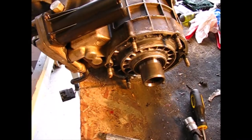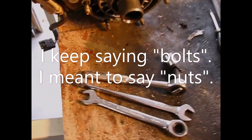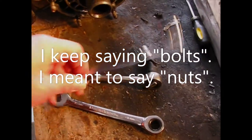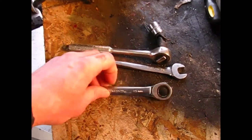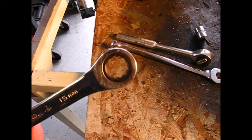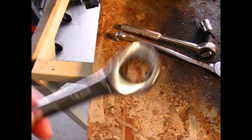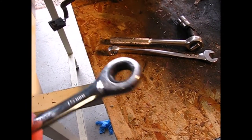Here's a piece of advice I think is going to help you do this quicker: the bolts are kind of hard to get out, like the bottom four — no big deal, you can just get by with a 15mm box wrench. The upper two, at about 2 o'clock and 10 o'clock, you're going to want to get a speed wrench — 15mm speed wrench, gear wrench, whatever you call these. Just go get one before you do the job; have it on hand. It makes it so easy, those bolts come out like nothing.